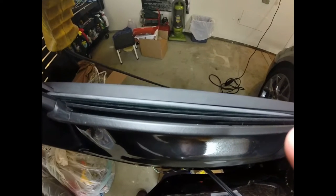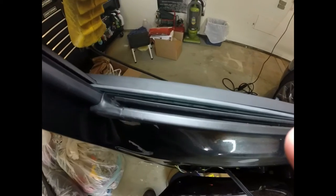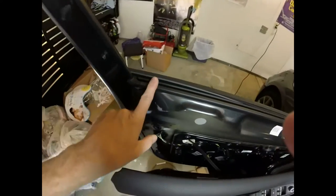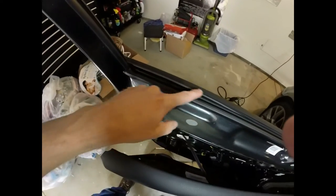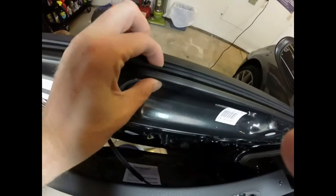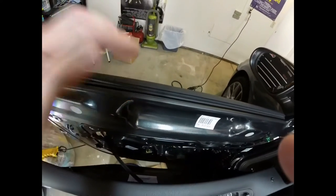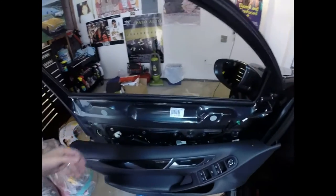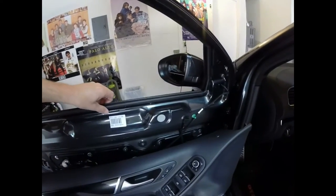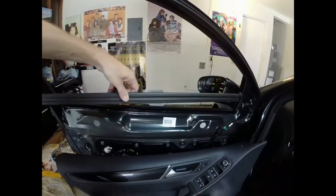What happened was I found this section of the seal was folded over on the window, all bent down. I did manage to pull it back up, but you can see it's all deformed and pressing in different pressures along the window, and sometimes it will squeak. Just to make sure it's not a real issue, I'm going to go ahead and replace that molding, which I think is this entire piece. I'm going to look at the new one before I yank on this and break something. It pulls right out — I just pulled it straight up. There's no bolts on this thing.